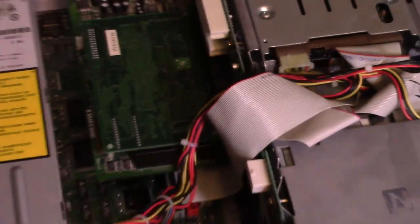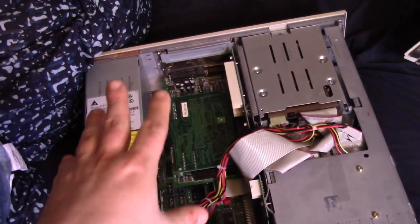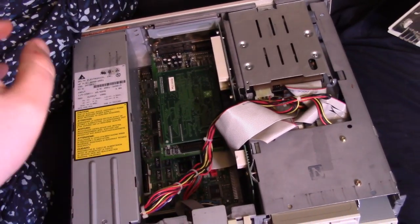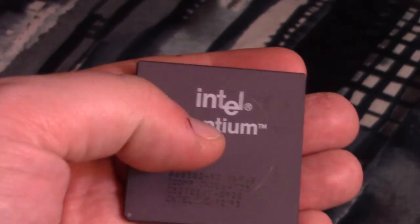So now I'm going to swap the CPU out, take out that overdrive. I have other machines that run DOS and Windows, and they run around that speed. I don't need another one that runs at 200 megahertz. So I'm going to swap that for the 75 megahertz CPU, and then I'm going to put in a discrete video card.